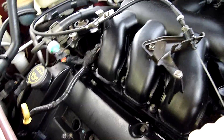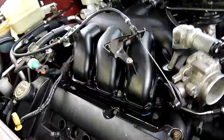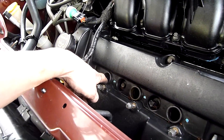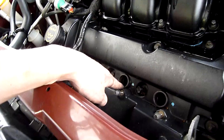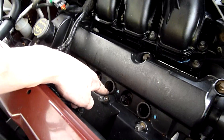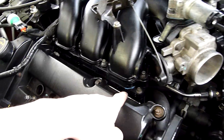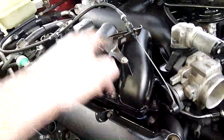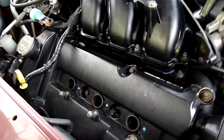I can always hear this hissing sound - not so much air hissing through an IAC valve, but hissing from the outside. Since these two cylinders aren't firing properly, that plug there was clean and somewhat wet, that one was sooty and had been firing. Disconnecting that coil didn't do anything, but disconnecting the other coil resulted in a very obvious miss and backfiring - dumping fuel into the exhaust. So either I've got blocked injectors, injectors not being fired properly by the PCM, or a serious vacuum leak pulling fuel and air further up into the manifold.